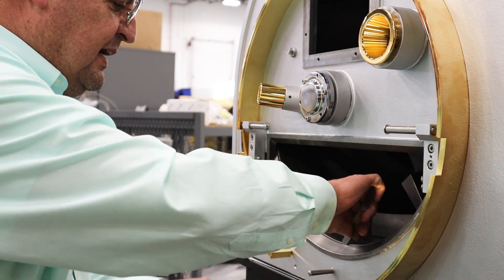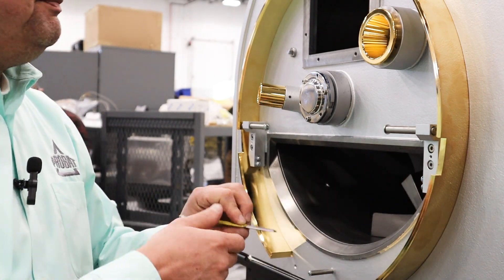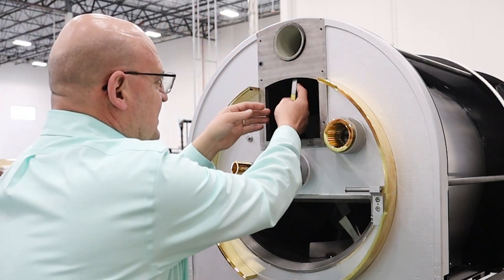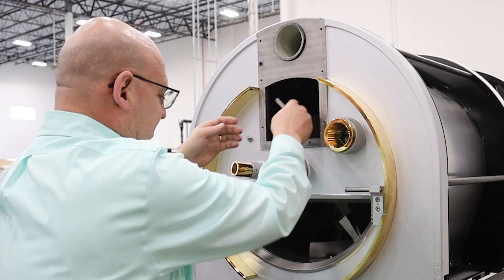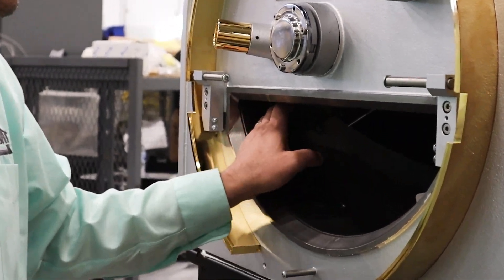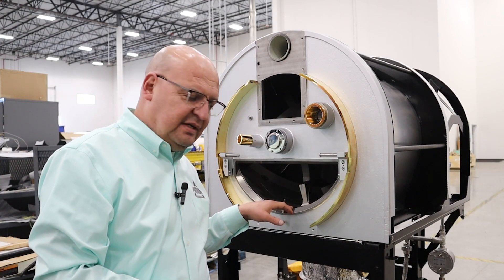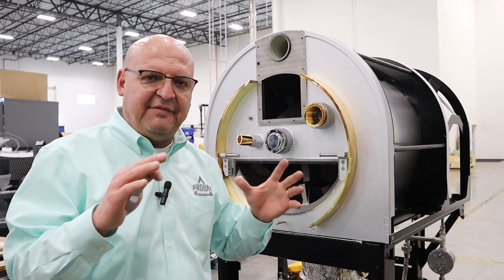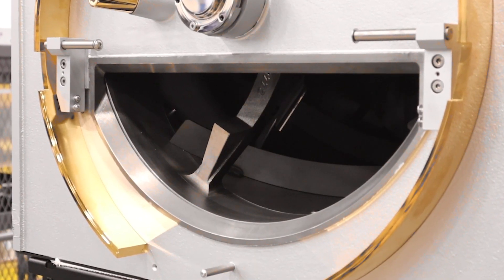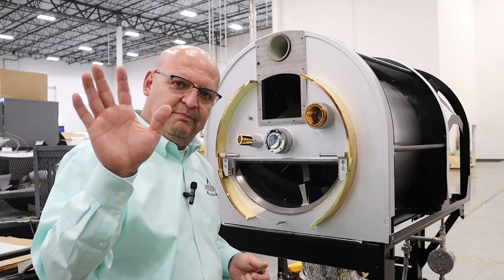Like right here — see, I cannot turn it. So that's 1.5, and you go here and here, 1.5. If you really want to verify, take the charge gate off with those screws, and you'll notice I can put it here, here, and here. When it heats up, there's no way beans can go through, and you won't have that rubbing — because if it starts rubbing, it creates tension on your motor and could potentially trip the breaker. Thank you for watching, see you later.